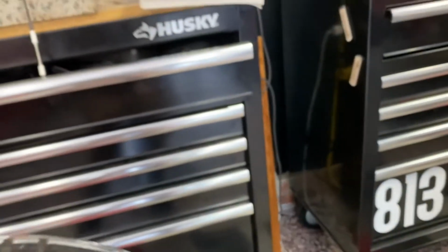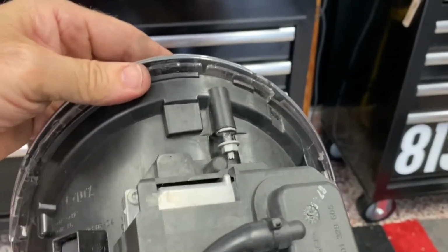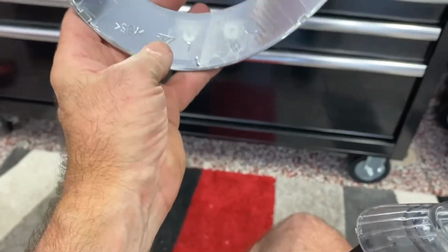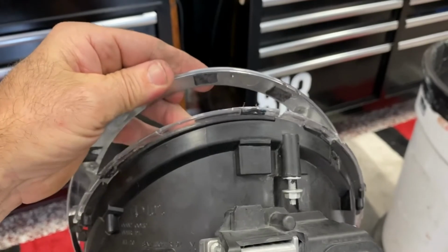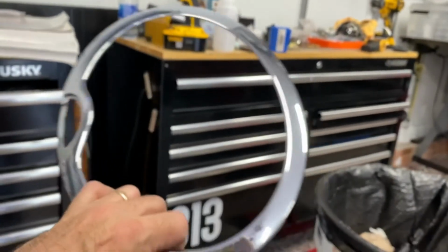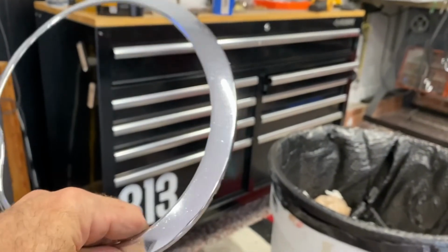Now once you get it off, again, this is kind of weird. This is the bottom, but once you get those off, then you just push it down. The tabs on the bottom are not clips; they're just tabs, and it just captured it. So one more time, this is how you get this thing. You get the top clips off, you pull it out, and then push it down, and then it just pops off. And it's plastic, so I'm gonna get that painted some color. I'm getting a new lightweight carbon fiber hood.